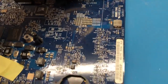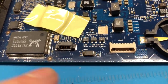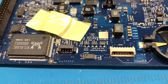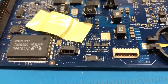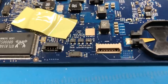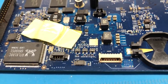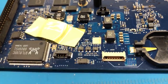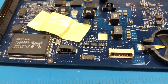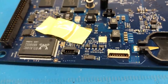Taking a look at the other side of the board, I want to point out that right here you can see an I²C EEPROM, more than likely used as the SPD EEPROM for the onboard system memory. If you've watched my previous RAM upgrade videos, you'll know that in more modern machines Apple puts the SPD data inside the main system ROM. But this one is so early that either they didn't know how to do it back then, or the BIOS simply doesn't support it. They had to use an external SPD EEPROM, which we can dump and reprogram for our newly installed memory.